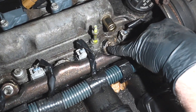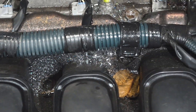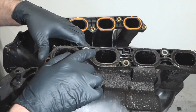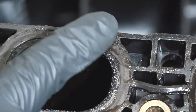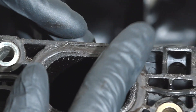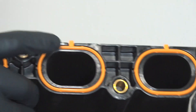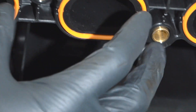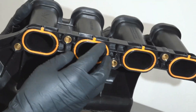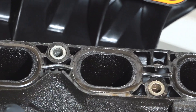Look at the bubbles right there. So if you look at this gasket, it is completely crushed — and that's not sealing anything. The only thing that was working here was the intake itself right up against the head. This is the way it's supposed to be: the gasket is raised up a little bit, and when you compress the intake against the head, that compresses the gasket and gives you a good seal. We didn't have a good seal, so that's why we got the code.